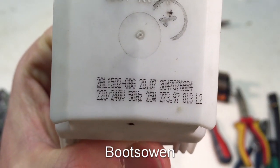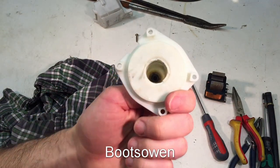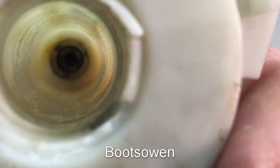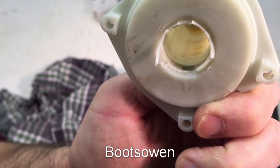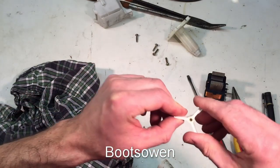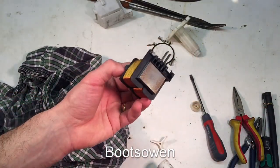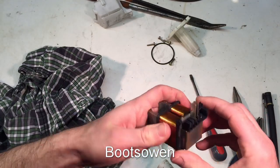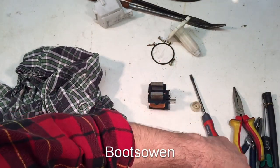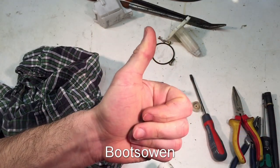Those numbers are on it — if you press pause you can see them. It's just a standard washing machine pump. You can see the zigzags right down the bottom. There's a little plastic bearing on the end, pressed in from the inside. There's the impeller blade — there's very little to it. This is the bit that does the work, and this is the bit that changes the energy from electrical to motion. Most of the weight in that is in steel laminations. That's what made her fail. Thanks for watching, see you later.